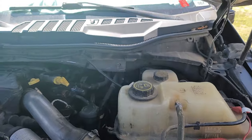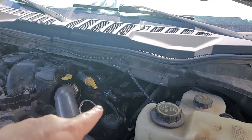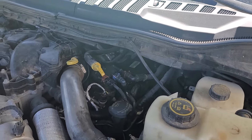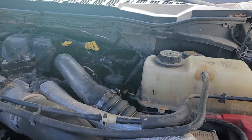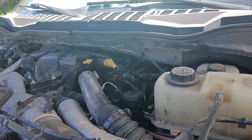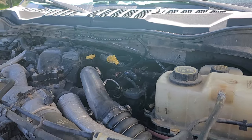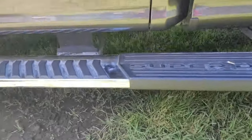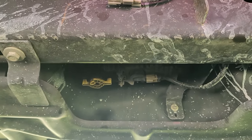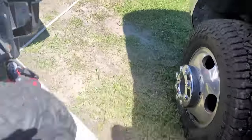I still had a crank no-start. Next up, this guy right here is one of my fuel filters. Those are supposed to be changed about every 15,000 to 20,000 miles. I last changed them about 20,000 miles ago, so I figured we'd do that. Here's the other filter — it's down here on the frame rail, that little yellow cap. So I replaced those two things.